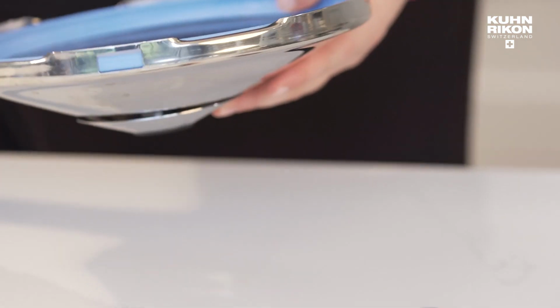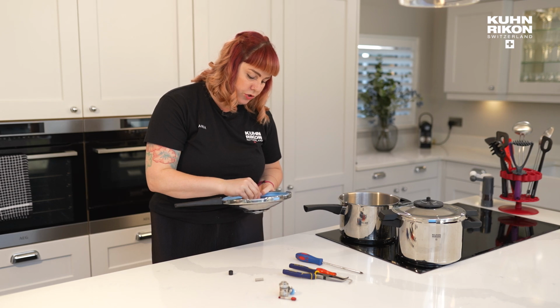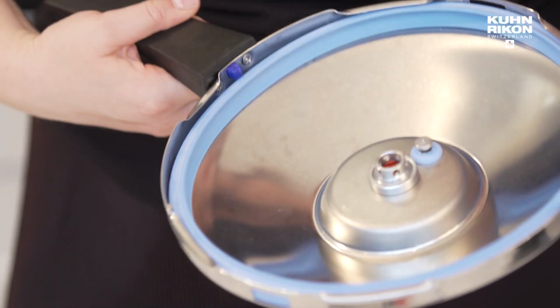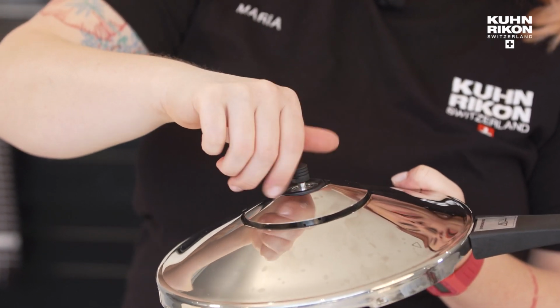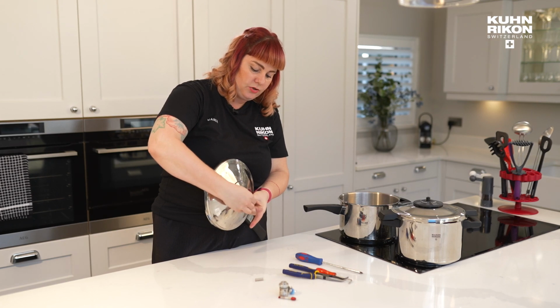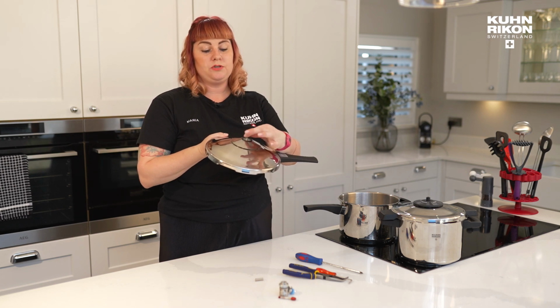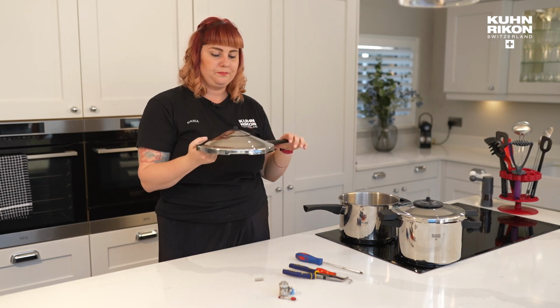And then you are going to go screw side first, because that is the bit that's going to secure your cap. You should see the red underside there. Use your finger just to hold, actually. Your finger can just hold it while you secure the black cap, just there. And then you are going to repeat your little test of pulling it all the way up, pinch, and then really securely on. And that is how you replace the stem valve. You can also purchase new caps. You can purchase new springs that go around the stem valve as well.